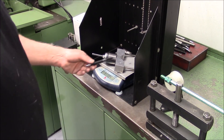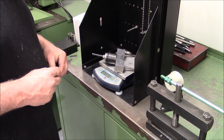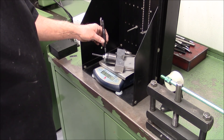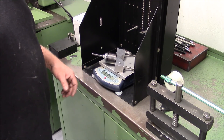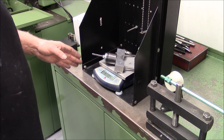What we have here is our half bob weight in the balancing station. We have a kit with different weights that we can put together to get to the target weight, which in this case is 1138.4 grams. Now we'll move on to setting these up on the crankshaft.